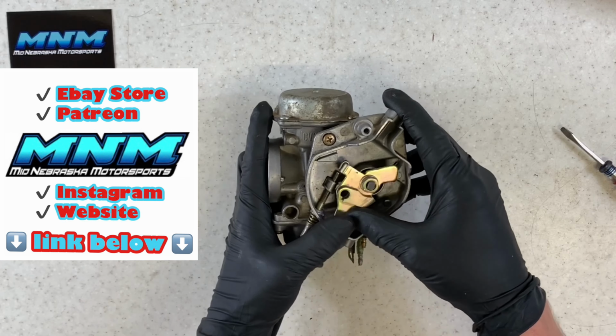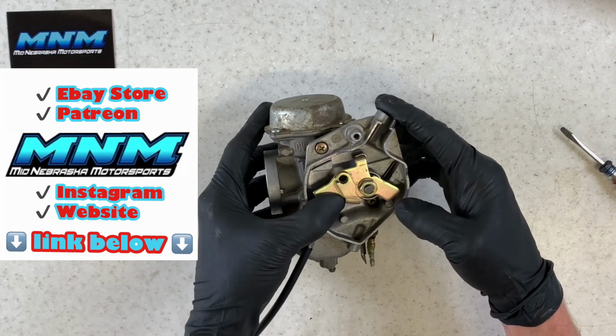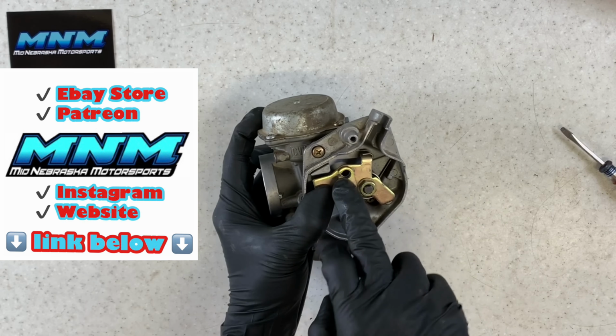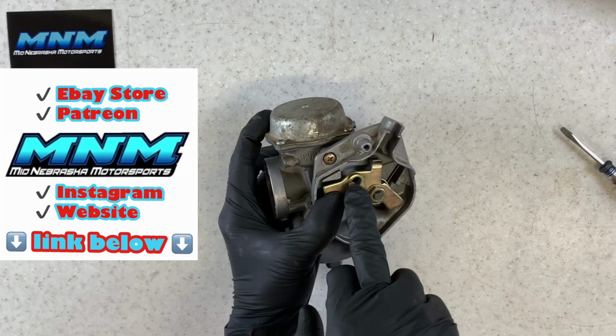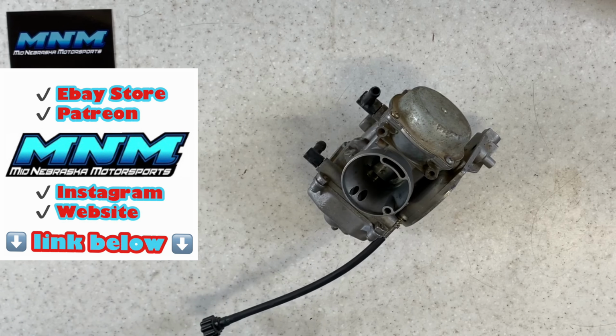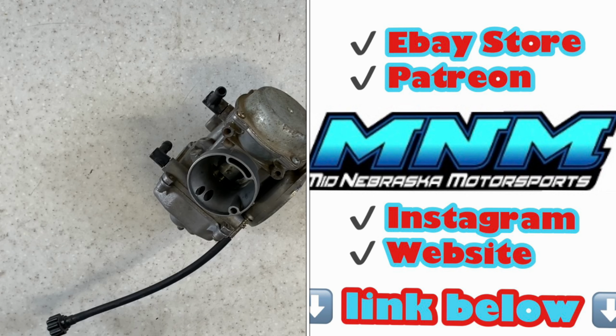When I put that cable on there, I actually take and push that butterfly up like that. That way there's some slack in that cable, and then you can slide it on and off in that groove there. So that is the carb clean on a 1999 Kawasaki Prairie 300.